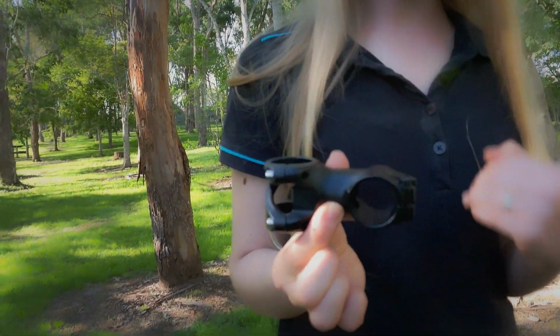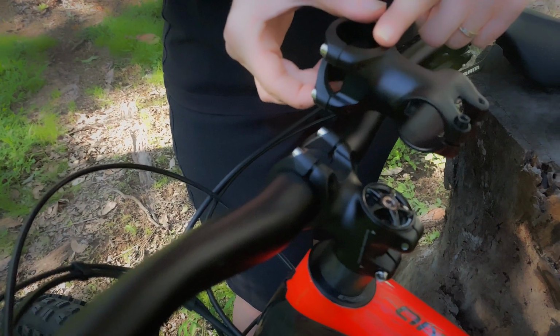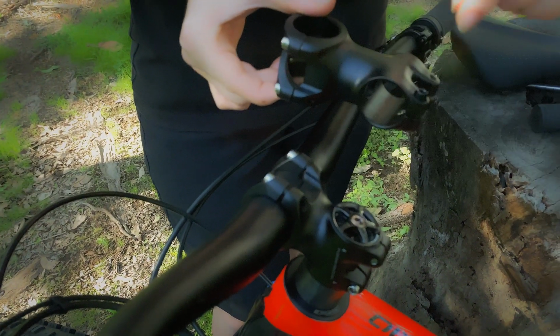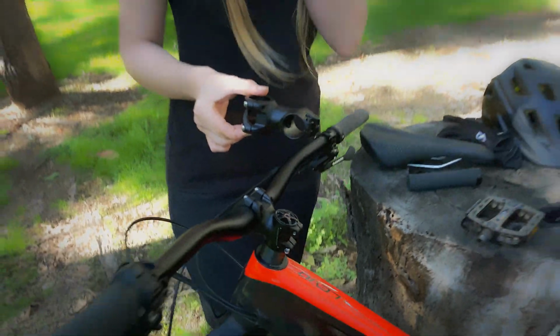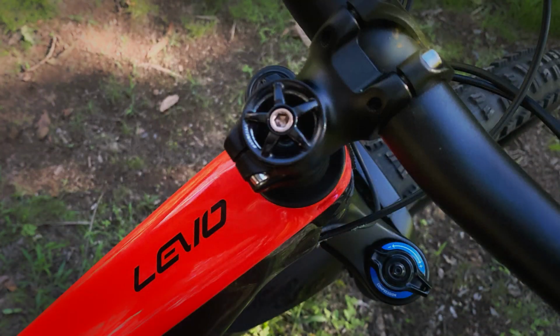The stem is another part on the bike that I have changed in order to make the bike fit me. So this was the original one, but as you can see, compared to the new one, this one is quite long. So I've shortened my stem in order to bring the handlebars back closer to me, which made it comfortable in how far I'm reaching. And also, for those of you who've been watching my channel and know about my back injury, it was also to do with the angle at which I was sitting. So that has helped me greatly.